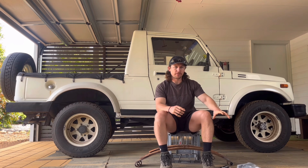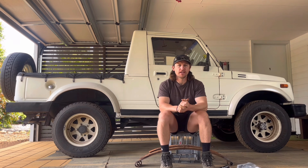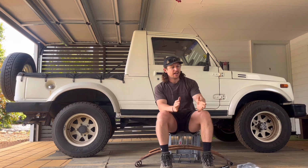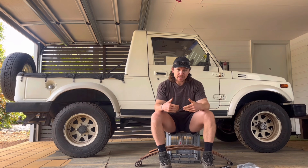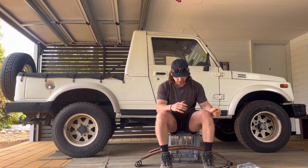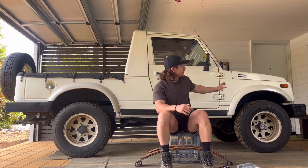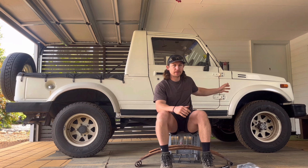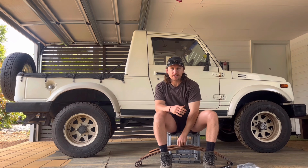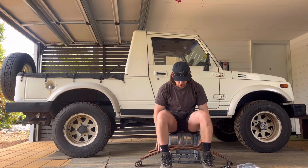They're going to go in, but what you guys are here for, most importantly, is the rears up front conversion. It's when you get some rear leaf springs and you make them fit at the front. I've put this leaf pack together for another car, for a short wheelbase Sierra, so I'm going to have to add another leaf to this because this is a little bit heavier than a short wheelbase, and it is running the G16B, which also adds more weight. So I'm going to add a leaf to this. And I've also retensioned these in the press, so they're good to go.